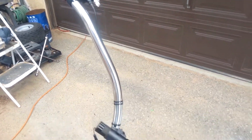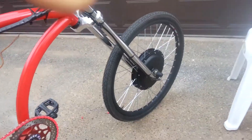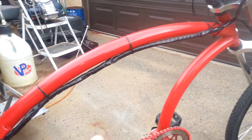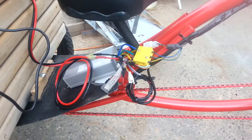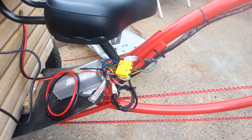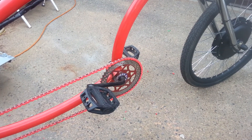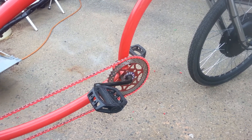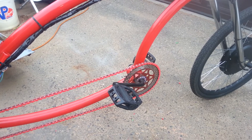I have the motor brake on both handlebars, so when you pull it, it automatically shuts off the motor on the tire. The power comes out of the side, runs up along here, and comes all the way down to that yellow controller. There are also black wires from the top to shut the motor off as an emergency brake. I didn't put the pedal assist on because I'd have to take everything off the back, and this chain has no master link — it's all solid.